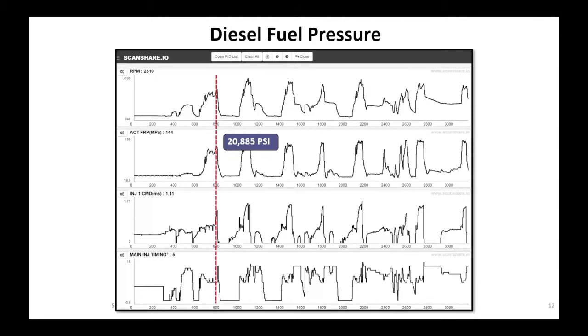Just think, if you're doing 2,500, 2,000 RPMs or so, the amount of time to get that correct amount of fuel in has decreased greatly. So in order to get the same amount of fuel in, we've got to increase the fuel pressure. So you're constantly going to see this fuel pressure. Over here we look at the RPMs and look at the actual fuel pressure. As RPMs go up, so does fuel pressure, to its maximum point. So we've got to have those high amounts of pressure.